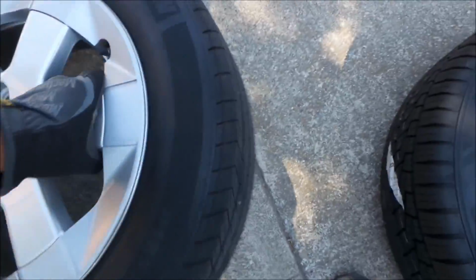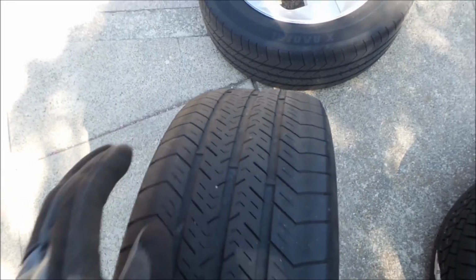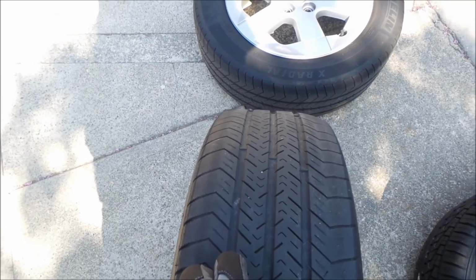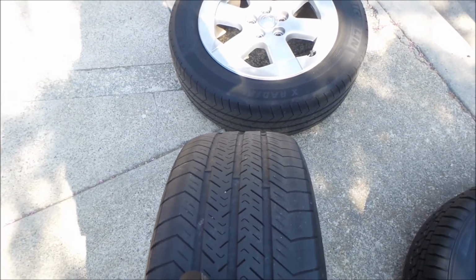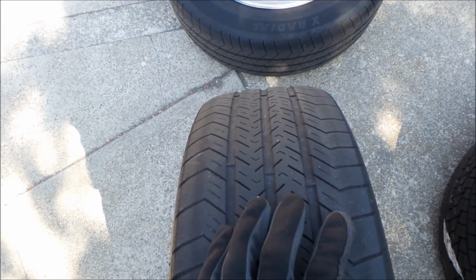Okay, so there definitely is something going on. Wow, this wheel is really light compared to the Celica wheel. Anyway, this one has less rubber too. So this one doesn't seem to have any inside damage. So I'm thinking the toe is off. The toe is off in the front is probably why it's wearing out, maybe. Or something wrong with the rear of this car. But I don't really notice any problem with the rear. The handling is excellent on this. This is one of the best handling Prius I've bought, so I don't know. I hope something's wrong with it.